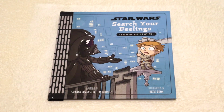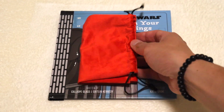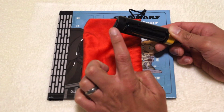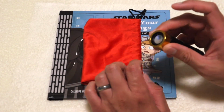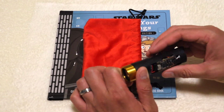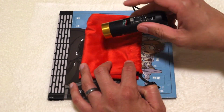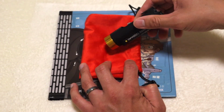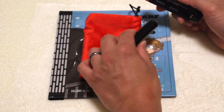So you're going to need a hard surface. I'm using a book, and some light padding, like a mouse pad is perfect, which I don't have, so I'm using the bag folded in fours. We're going to do some light tapping on the board here. It's very important: don't tap it on the pin side. Make sure you tap it on the speaker side, because it's a little bit more structurally sound there. You don't want to ruin those pin leads. So you're going to give it a couple of taps on your hard surface. My hand positioning wasn't very good here, so I recommend putting your fingers in a pinch a little bit more towards the center, and boom, there it is.